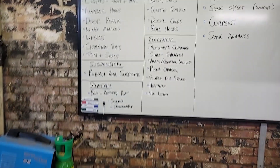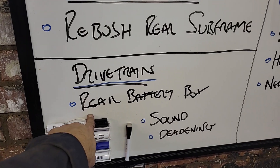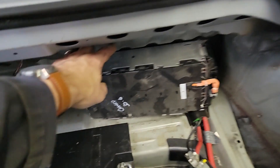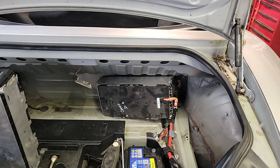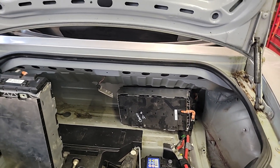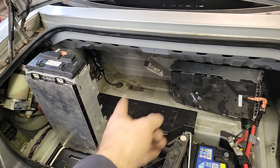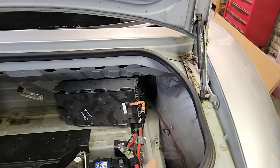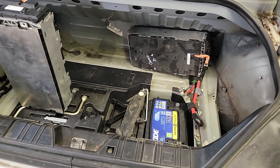One of the big things on the list is the rear battery box. I want to double my range with an extra five BMW hybrid modules. The boot is a slightly awkward size, particularly with this shelf that drops down from the inside. Without radically moving things around I can't easily fit many modules in there. I could just about squeeze two side by side but it'd be very tight and I'd have to reroute the brake wiring — not a big issue — and the 12-volt wiring, which is slightly bigger. There are some chunky cables but I could push those up to the edge and bring them out and around.